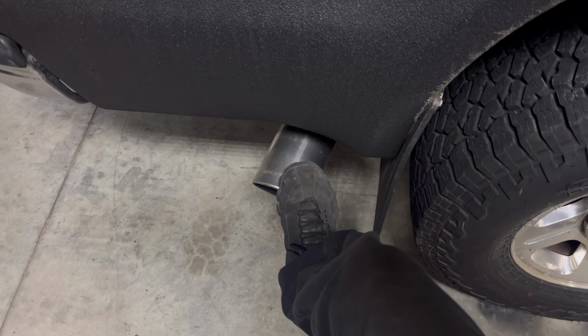I'll sell some Garrett turbos. Seriously, I'll sell Garrett turbos like some go. Garrett does not take 100% of their housings. Whoever is actually molding it does not use every single one of them. You know, there's a failure rate. Maybe if I had one that was not ground on, was not touched, and all the casting is raised, because you should feel the casting line, right? It should raise above, not below.